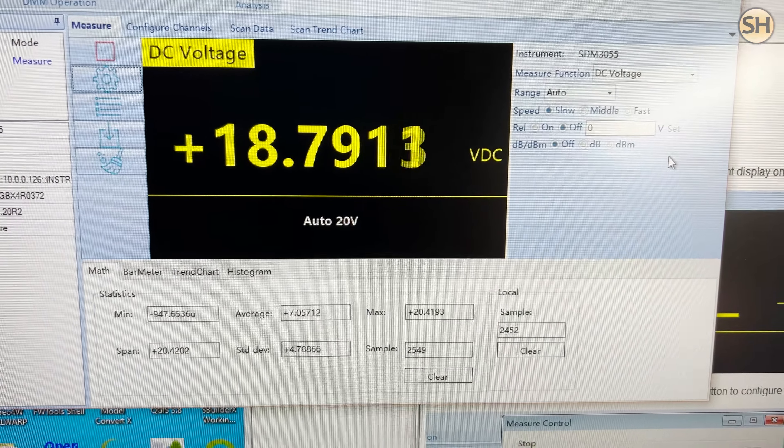I'm going to bring this down to about 18 volts. The pump will take 24, but I'm trying to use as little voltage as possible — it may use more amperage, but we'll see. I've got this down to 18 for now. I may turn that up as I do some additional testing on the pump flow, since it has a lot of line to go through feeding water through a long tube and up into an external computer. That's the DC to DC converters I've got as part of my silent chiller setup — got some more work to do, but we're getting close.